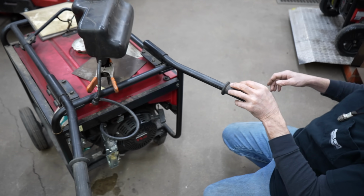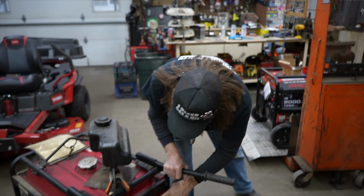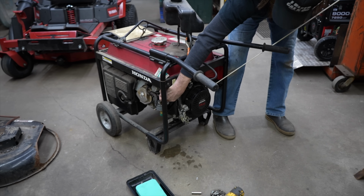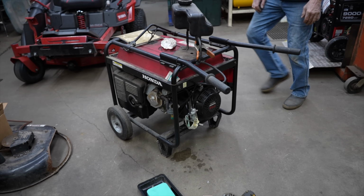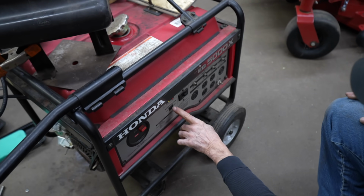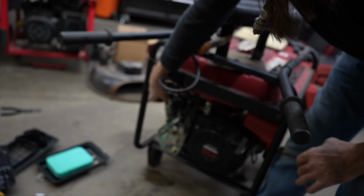And the engine switch is on. It's full of oil, so it's not the low oil shutdown, because I said it had spark. It'll just run and die. Let me choke it by hand. All right, I had that auto throttle on. Let me try starting it again. Because as soon as I turned it off, it died out.